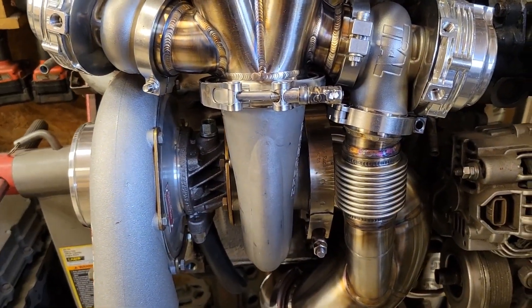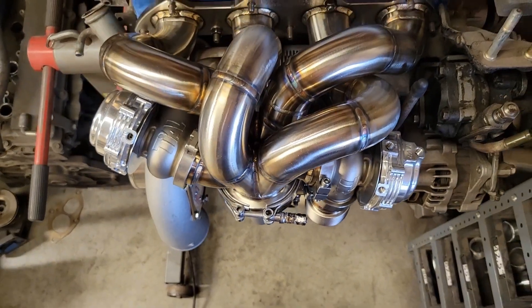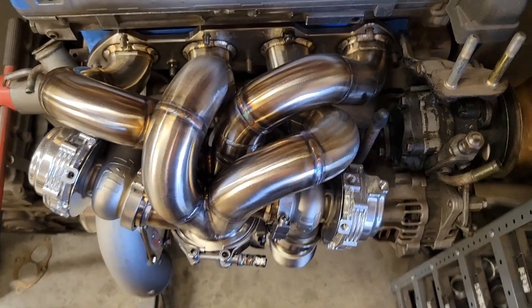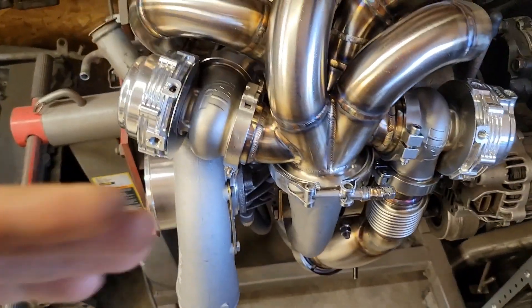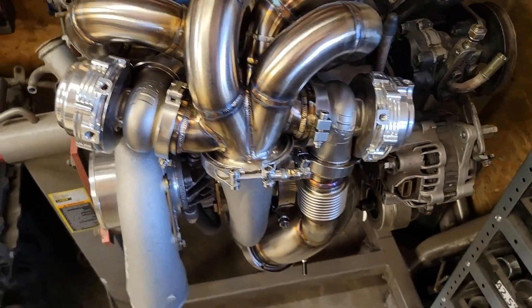The V-band TH4V is quite large. We did tuck everything as close as possible, actually close enough where you should be able to fit a factory radiator, but everything can be so close it'd be hard to work on, so they are going with a half radiator. That's why this additional wastegate is tucked back like it is.